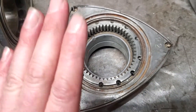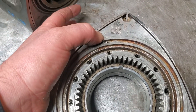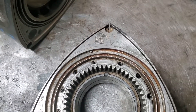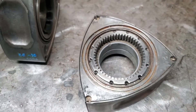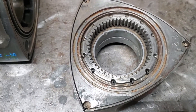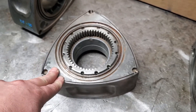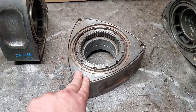You'd obviously want to get your rotors rebalanced. And really, even if I have two matching rotors that were both E's, I'm still going to have the assembly balanced because we're not balancing rotor to rotor. When we're doing high-speed balancing, we're balancing rotors to counterweights, creating a smoother operational assembly, just like you would with a piston motor, an airplane, or anything you're trying to cut vibrations. With rotaries, it's fantastic because they're an on-center motor, a hundred percent duty cycle. So when they are properly balanced, they're exceptionally smooth.